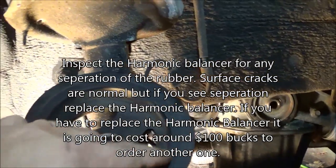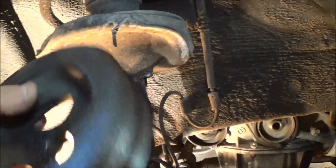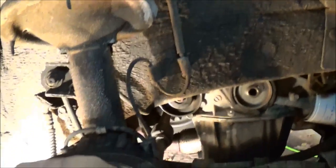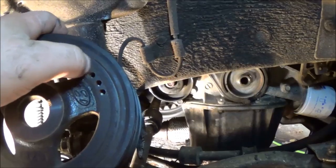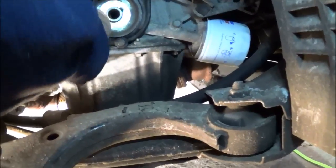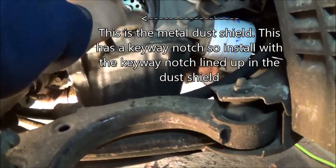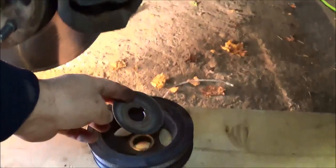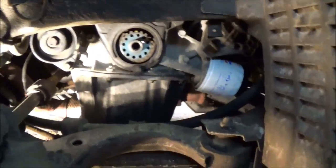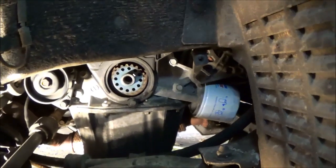You're going to want to inspect this seal right here — this is the dampener ring; make sure it's not separated. That looks pretty good. You'll see a couple of holes right here — I'm assuming these holes on the back of the balancer are to put a tool in to hold it from spinning while you crank down the bolt. Notice the keyway goes on back the same way you took it off. There's the crankshaft; there's the keyway right in there. Now we can take off that bottom timing belt cover.